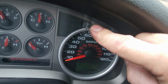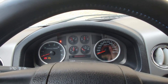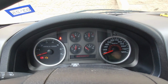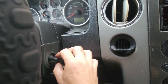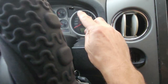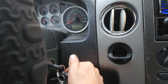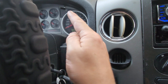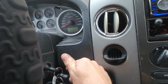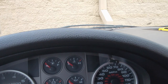Hold it down — okay, it's reset. Now we're gonna turn the key off, one, two. Then we're gonna hold the brake down and hold this reset button and turn the key two clicks. The key is gonna be at Trip 1 while we hold that reset button and the brake and do two clicks.